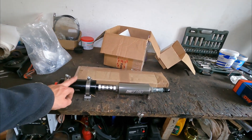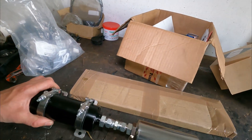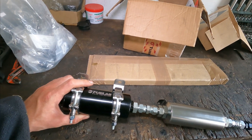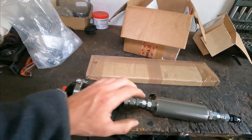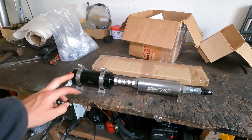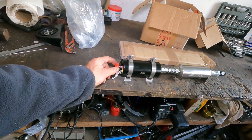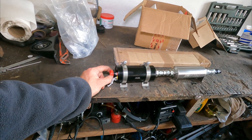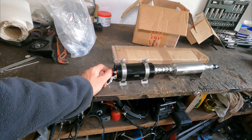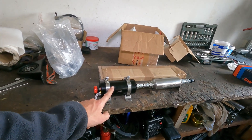This is a FuelLab fuel pump — it's rated for like 1300 horsepower on regular fuel, no E85 and that sort of stuff, but this pump can also do E85 and E100 — I think it's rated for fully alcohol. Very big pump, but it's pulse-width modulated because I don't need that much flow. I could use a smaller pump, but these were more in stock and the price was the same, so why not use the biggest pump if you can just rate it with PWM.